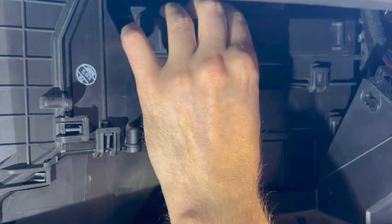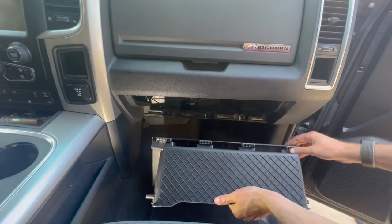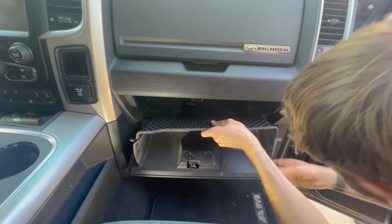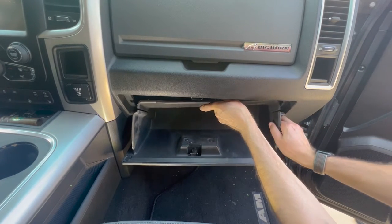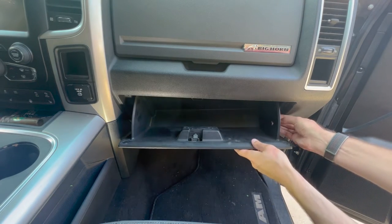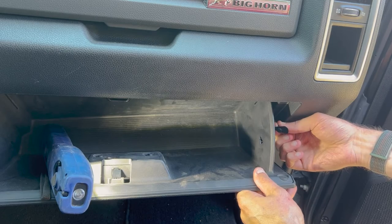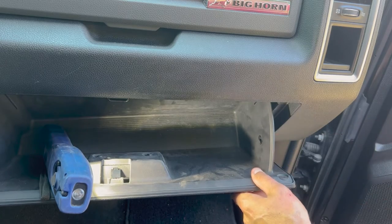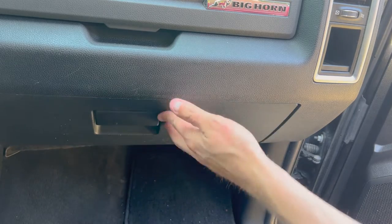Next, reinstall the glove box. There are four hooks on the bottom side and a bar it hangs on, so set it on those hooks first. Before you lift it up too far, reach in and grab that soft-open soft-close rope piece, then lift up the glove box, squeeze the sides again, and set it in place. You should just be able to lift up the glove box slightly, slide that clip in place, and set it back down — it should pull up into place, and there you go.